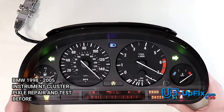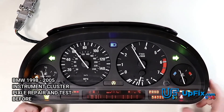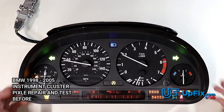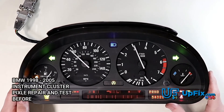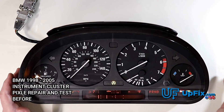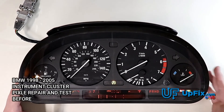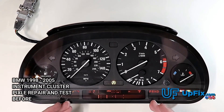This is very important to do because a lot of people who try to replace the LCDs themselves destroy the gauges. These gauges are coil-wound and any vertical pressure will pretty much destroy them. We don't repair the gauges on this cluster, so if you have gauge issues don't send it in — each gauge can cost $50 and upwards, and tampering can cause a nightmare, especially if someone just wanted to replace the bottom LCD.